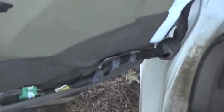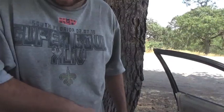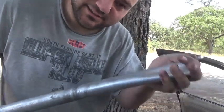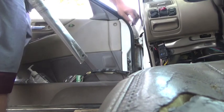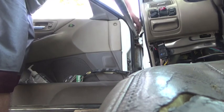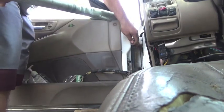So what I'm going to do is now remove those bolts carefully. Here's my weapon of choice. My 12mm ratchet won't fit inside there, so 12mm box wrench, cheater bar. This is going to work great. I'm just going to break them loose. If it helps, put the box wrench on the other way, because it will definitely help. See, I can now fit my cheater bar in there much easier. And righty-tighty, lefty-loosey, so counterclockwise. And look at that, it's broke loose. Do this to all the bolts.